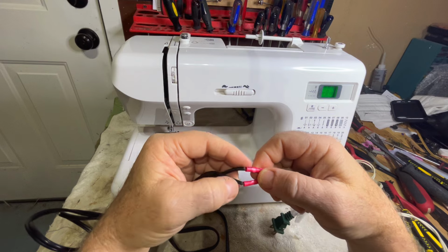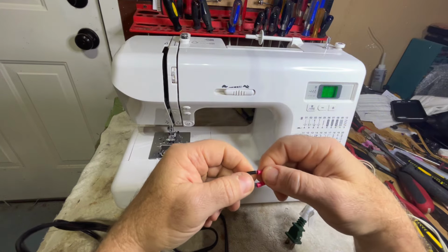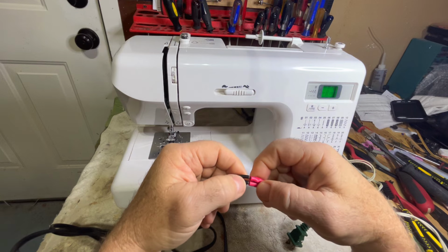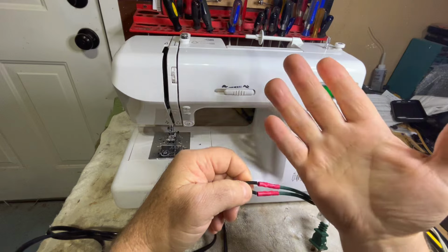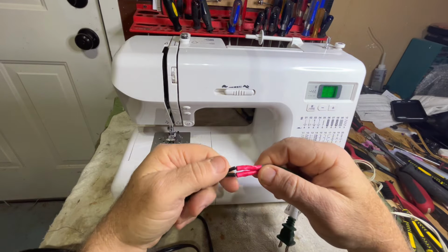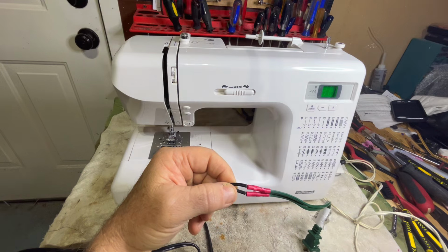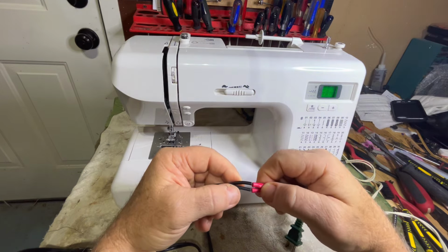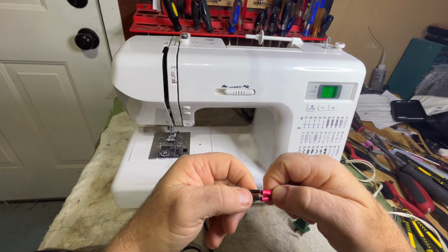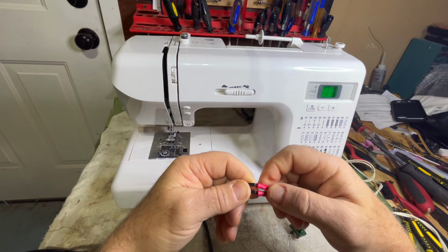As well, if this starts fraying, or if something conductive falls across it, you can get arcing. That's a two-part thing. The likelihood that it would cause a fire isn't real likely. It's possible, but not real likely, because of how breakers and such are made today. Depending on their house, if their breaker doesn't pop, or if they have fuses and the fuses don't pop, it increases the likelihood of a fire. But providing everything works properly, you could blow a fuse or pop a breaker, which isn't a big deal, but it's an annoyance.